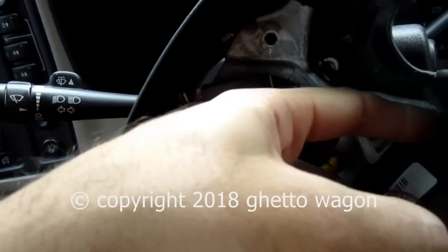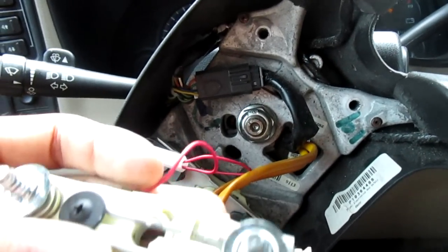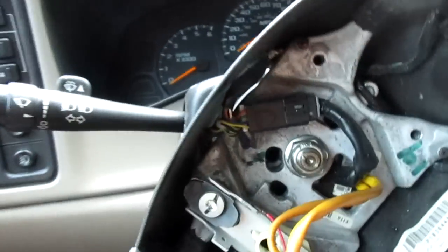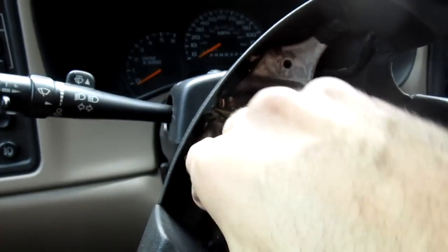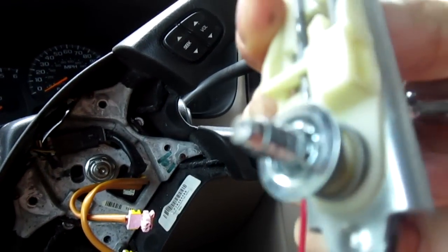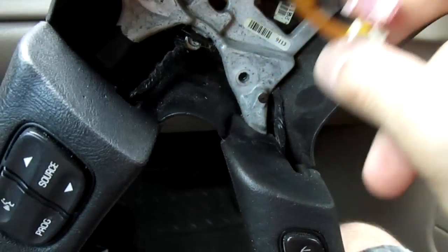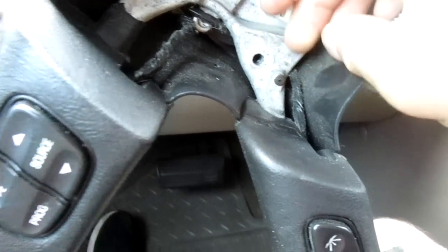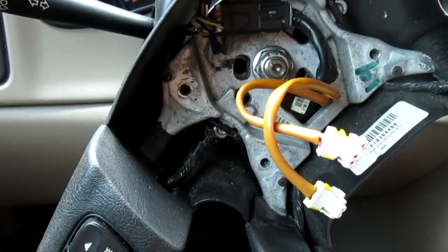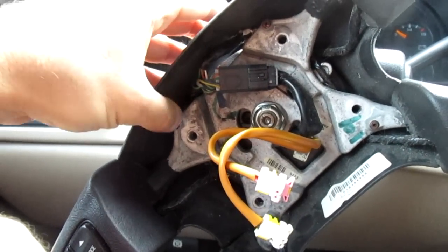There are the other contacts right here. These actually could be dirty — maybe we did not clean these before, and maybe I won't need a new part. They put the new part in anyway because this is kind of worn. So clean these with Scotch-Brite — there are actually four contacts. I'm probably gonna keep this old part too. Just remember the white tab goes up. Let me get a little piece of Scotch-Brite and clean up all these little contacts because they were pretty nasty. Without even replacing the part, this cleaning might fix it, because it did work for about a week after I cleaned it before. You could try that before buying the whole part.